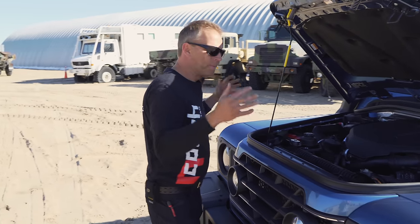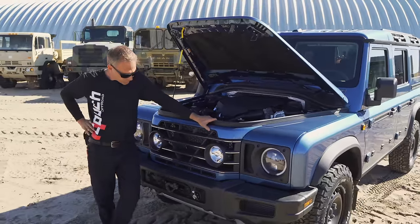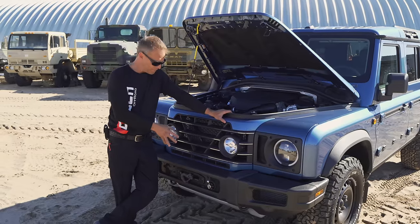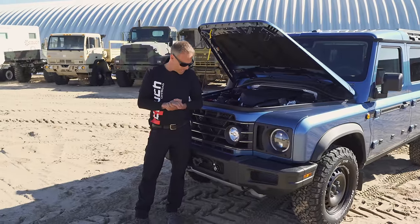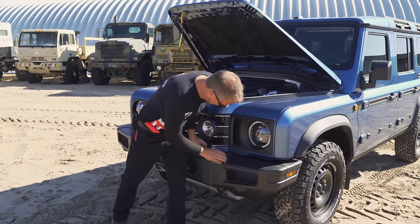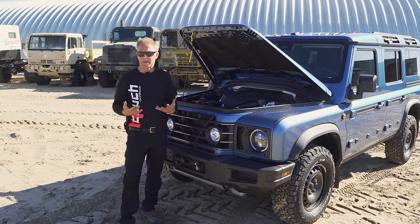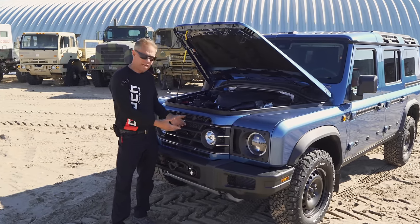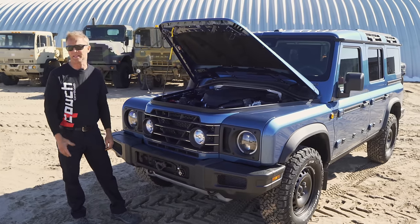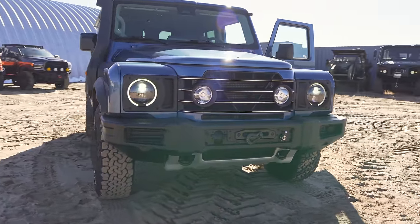The construction of this truck is a bunch of galvanized steel panels and aluminum panels as well — it's a nice setup. We ordered this one with the factory winch on there. We're going to build a full custom bumper with a modularly integratable bull bar and a different winch setup. This one is pretty low on winch cable — I think it's only around 50 feet, maybe 80. The problem with this setup is I hit everything, and the sheet metal is not overly thick — par for the course but not quite good enough. We're going to create something that handles a same-size or slightly bigger winch depending on crush zones. The lighting is phenomenal — the headlights are great. These auxiliary lights only come on with certain off-road mode recipes, so we'll come up with something there.